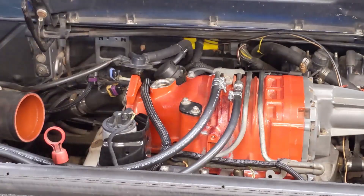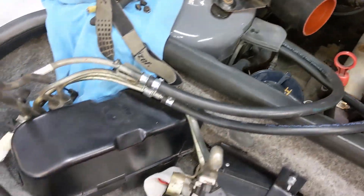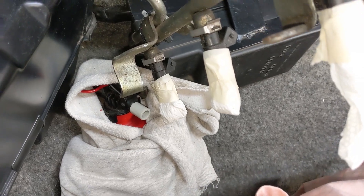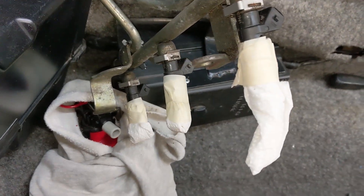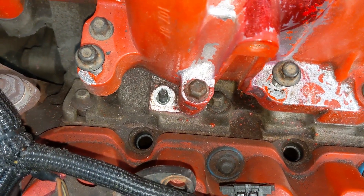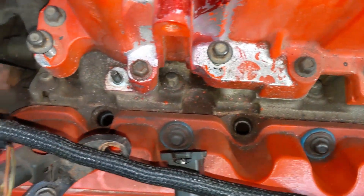Next, I'm going to go ahead and remove the main vacuum port, and start to remove some of the wiring, and release some of the clips that I have fastening it in place. We got the fuel rail off, and I just want to show you these injectors. They're pretty sensitive, and the last thing you want to do is bung up the end of them. So I've cleaned with a nice fresh towel the end of each injector, and I've wrapped them in paper towel and tape, so if anything bumps into them, there won't be any damage. The injectors pop into the cylinder head, and this is one of the reasons you want to do a good job cleaning with the air hose before you take these out, because you don't want a bunch of junk falling in there. I'll take a vacuum cleaner and a cloth and try to clean that out even better, and minimize the amount of debris that falls into those holes.